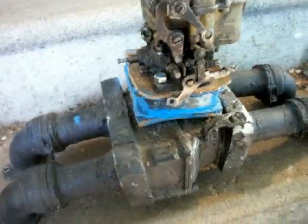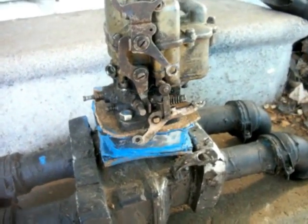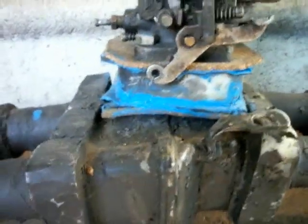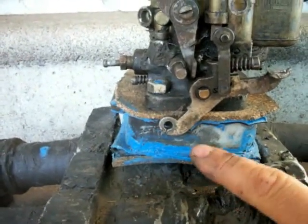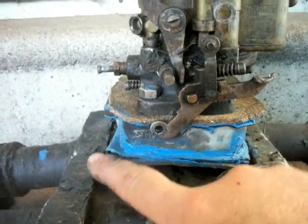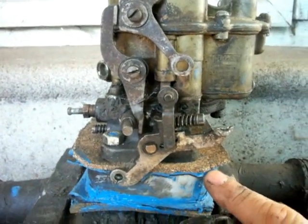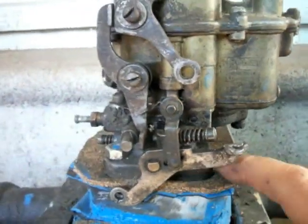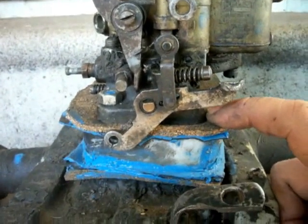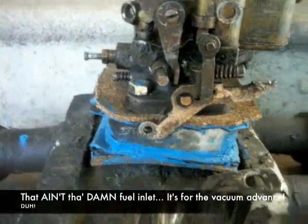Been experimenting with thicker gaskets. On a cold day, the carburetor will pop back and blow out the base gasket. So you'll notice that I have rubber inner tube here with cork and rubber gasket material underneath, and there's RTV on the bottom, in between each, and on the top where the spacer plate goes. Then there's another section of rubber inner tube, cork, and then the carburetor sets here, and the carburetor gets a thick chunk of RTV too. Like I said, people may laugh at it, but it works really good. It's cheap as hell, and I haven't had any major problems with it since I've been running it.